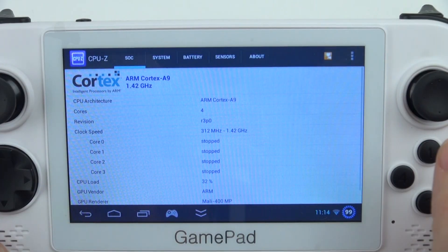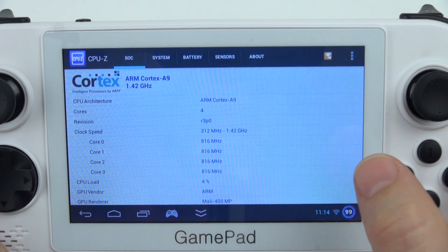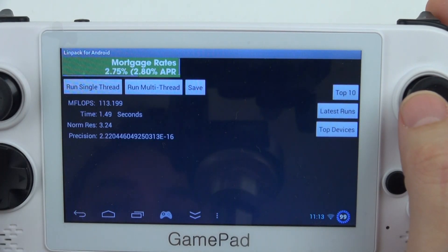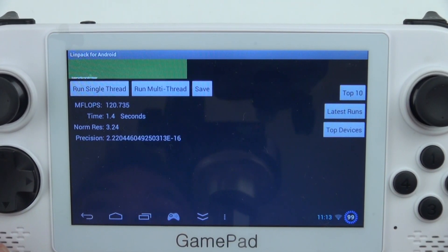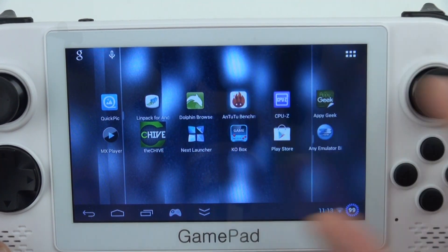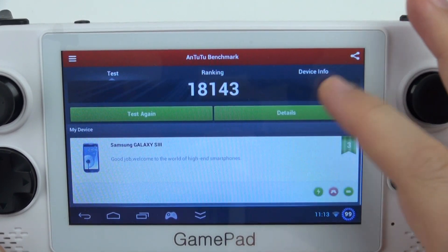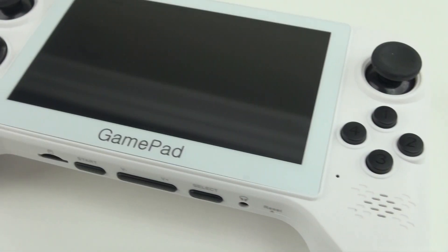Let's take a quick look at the CPU. It's running the Rockchip 3188, a quad-core ARM A9-based CPU — kind of standard performance, a lot like other Android mini PCs. Running LINPACK, it's getting about 120, which is exactly what most of them get. And on Antutu, it gets a nice high score of 18143, which might be partially because the screen resolution isn't that high — going to full 1080p seems to drop performance a little bit.